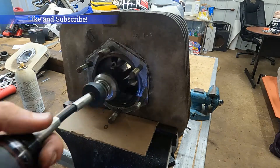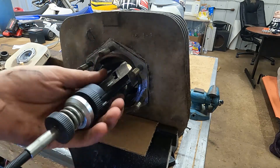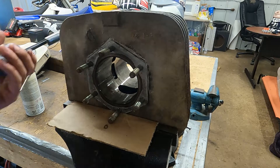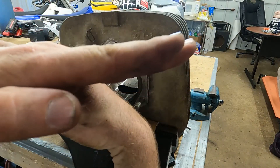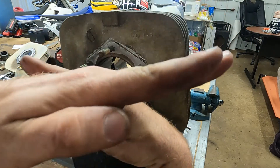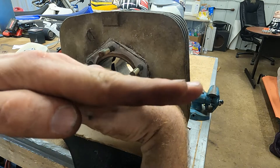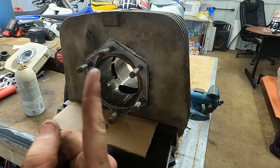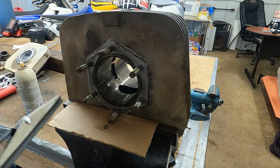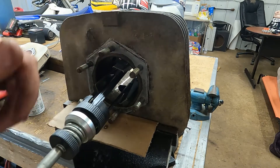I don't remember exactly what it is — if it's like 15 or 30 degree crosshatch you want in your cylinder — but you don't want to just put your drill as fast as you can go and move in and out super slowly. You want really nice crosshatches. You don't want super aggressive crosshatches that are like 90 degrees apart; you want them kind of laid down. If your drill is going too fast and you're moving too slow, it's really just going to have straight lines around. You want them to kind of coil up and coil down. Because this cylinder is so rough, I'm going to put a little extra spring pressure on and spend extra time going through it. Make sure your stones are coming all the way out of the bore in the front and all the way out of the bore in the back.